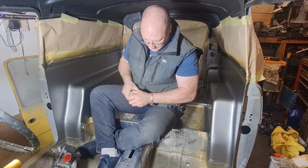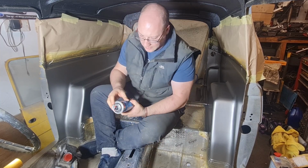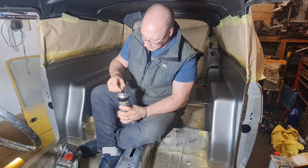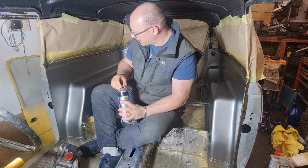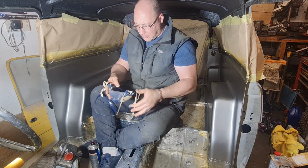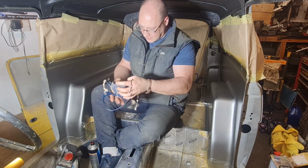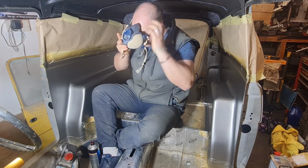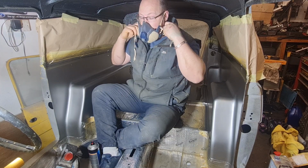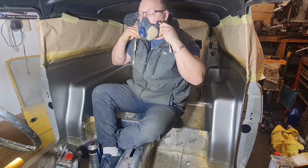Alright, I'm gonna go with that, I think. I'm gonna be all day. Alright, this has got a fan adjustment on this as well. I'm gonna go fairly big on the fan because I want to get a good coverage on it. Right, you might not be able to hear me very well with this on. But we will try. So as I say, dust coat first. We'll do that, let that go off for 5 minutes, then we'll come back and do the main coat.